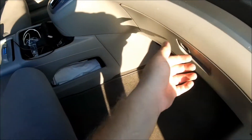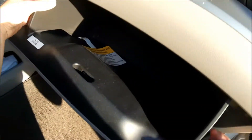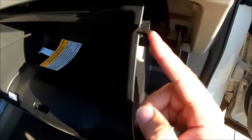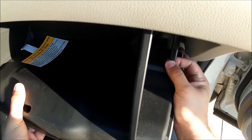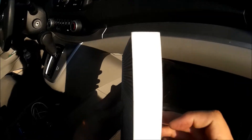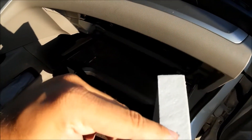To start, drop the airbox. Honda has a little tab you squeeze, and then there's a little strut here so it doesn't slam down on your knees. Now we've got the airbox open. There's a little plastic clip — squeeze on both ends on that little square piece — and let's pull the old filter out. You can see it's a little gray and dirty.